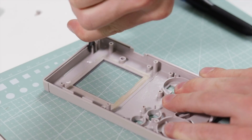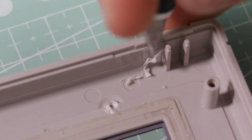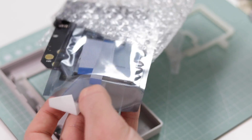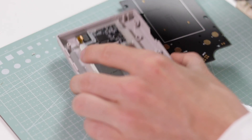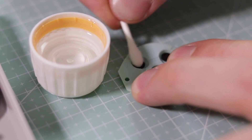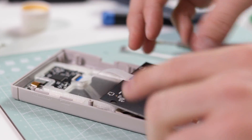This IPS installation process is very simple — everything is pretty much done for you besides soldering a speaker and plugging it all in. We need to remove some plastic to cater for the new screen, then assemble everything into this 3D printed guide. All of these parts have been supplied by Retro Modding and will be linked below. We can reinstall the buttons and give the rubber membranes a clean with some IPA to improve reliability. Solder in the old speaker, screw the front back in, pop the back on, and we're done.